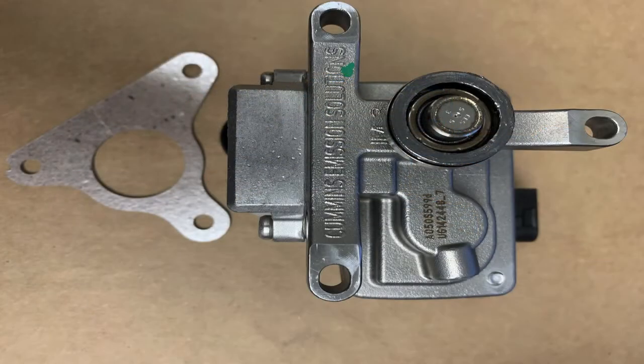And here is one last view. It's laying on its back and you can see the spray tip there. You can see the groove around it where you press in the fiber washer. You can see how the steel gasket will lay over there, and it's an insulator too — to keep the heat of the DEF decomp pipe from heat soaking into that aluminum housing. So the only thing you've got is the three bolts that really make a good heat transfer, and they don't do that well of a job. So you're in good shape.